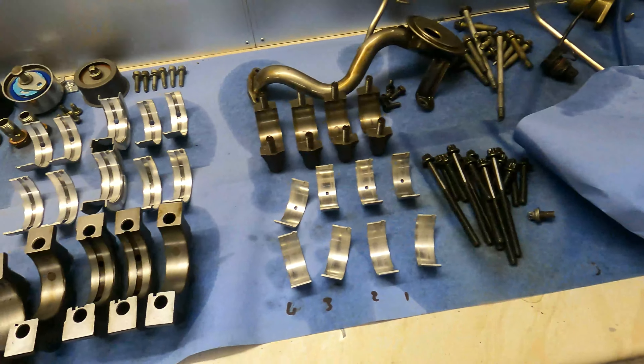I couldn't get any standard oversized bearings, so we've got ACL race bearings to go in — nice little upgrade. That's the new crank cleaned up spotless, all the oil ways blown out, all the journals degreased. Compared to the old one, this is the one that's got all the problems and it doesn't look horrendous even now. There's a new journal, there's an old journal — must just be the shape of it, all worn.